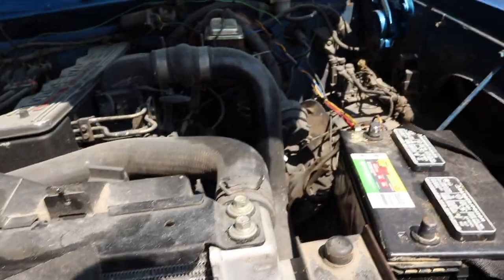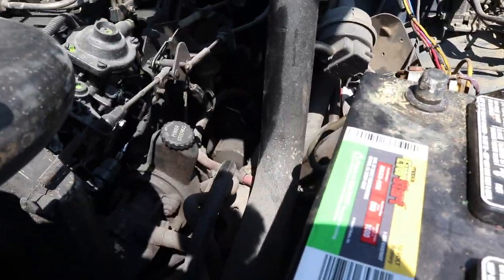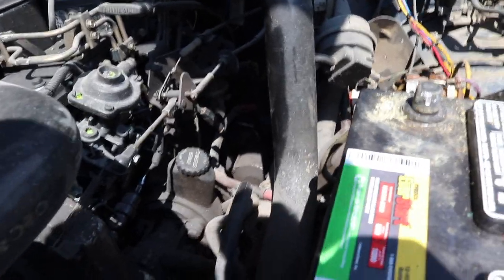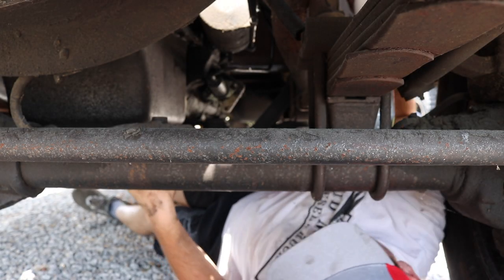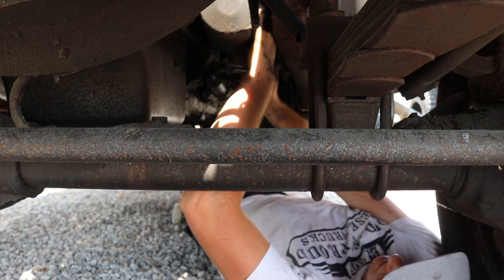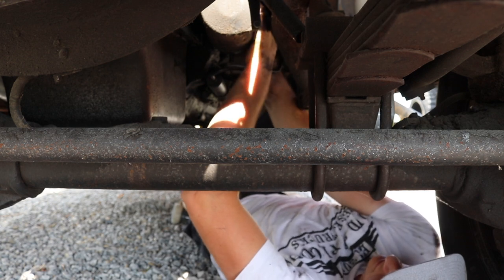Now what I've got to do is replace the starter on this truck, which means I have to disconnect the battery — which is already done — and then pop off the positive cable going to the starter, which I believe is an eight mil. Then there should be three more bolts on the lower portion that I've got to take off, drop the starter, and take it into NAPA. They'll take that as a core charge and it'll save me about fifty dollars on my new starter. I definitely should have put this thing in the garage so I had rubber mats to lay on — this gravel is pretty sucky. I'm on my last bolt, going to loosen it up a little bit and once I can thread it out by hand...